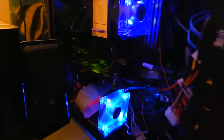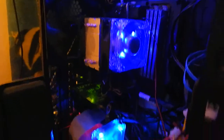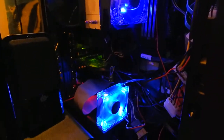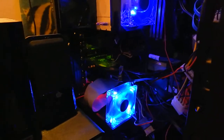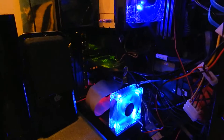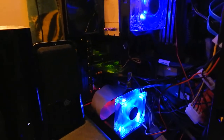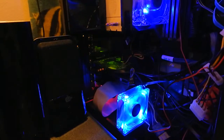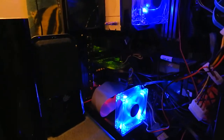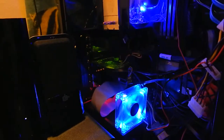As you can see right here, the power supply unit is definitely running — if it wasn't running, these things would not be running. I was talking about the green indicator light on the GPU. The power indicator on the GPU itself was intermittent. Then he thought it was supposed to be flashing — no, it didn't work. It worked before and then it didn't work. It worked originally, and then it wouldn't turn on. So I did the whole routine: turn off the computer, unplug the computer, push the power button until the green light on the motherboard is out, then disconnect and reconnect. And lo and behold, the green light turned on the GPU after I plugged it back in and turned on the computer.